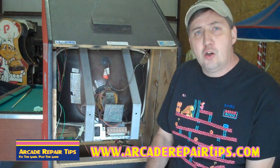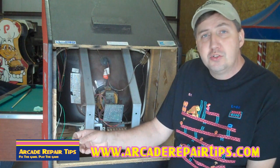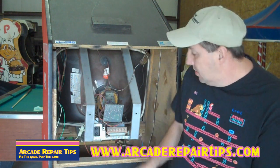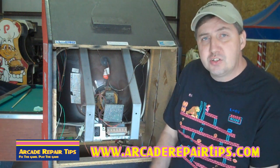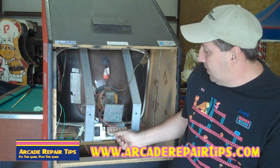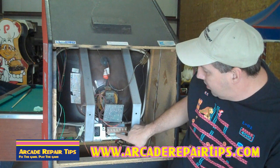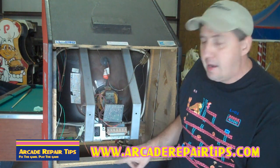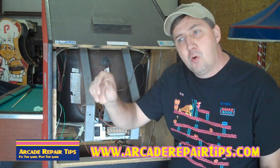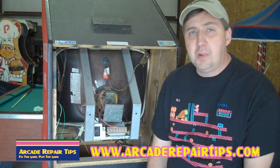We're just going to turn these little white knobs, which are called pots — short for potentiometers. Think of it like an old school radio or TV, when you turned up the volume you actually turned a knob — that's a potentiometer. This is a very small version of that; all you're doing is turning up or turning down. That's how we adjust: the horizontal position, the vertical position, the brightness. Remember there are two brightnesses, one here and one there. Sometimes it takes a little more brightness on one side and a little less on the other — you just have to play with it.